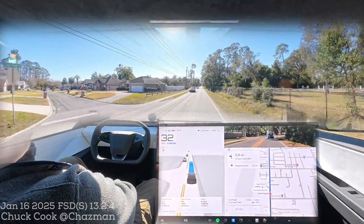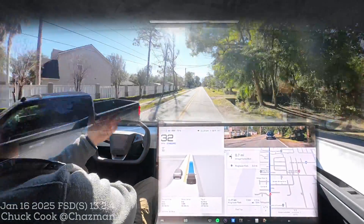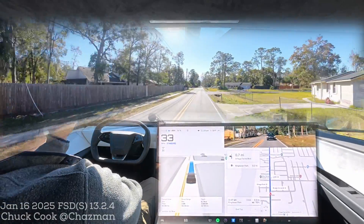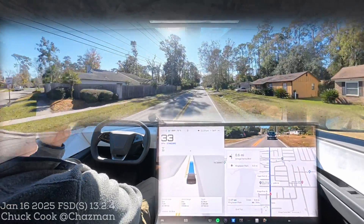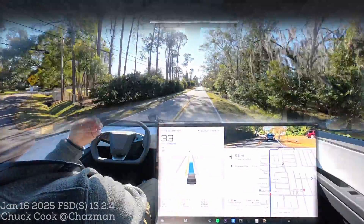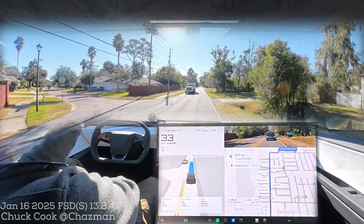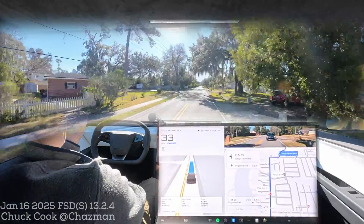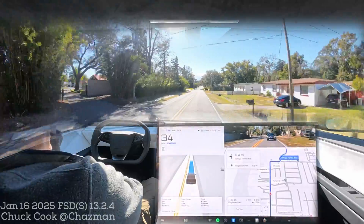The B-pillar, for those who haven't heard this before, is too far back in my mind for a single 90-degree view of high-speed cross traffic. I'm not worried about low-speed cross traffic because the creep will work — but for high-speed cross traffic, just like that unprotected left turn we just jumped out in front of, the range and distance of a single camera hasn't shown me it can find the right gaps, make the right decisions, and estimate speeds appropriately. The creep is a mitigation for a camera so far back, whereas cameras on the front of the car would eliminate the need to creep at all — that's what I mean by superhuman placement.